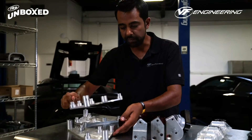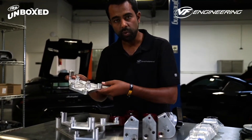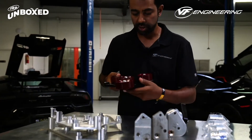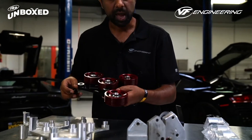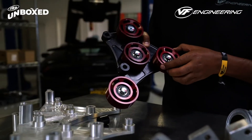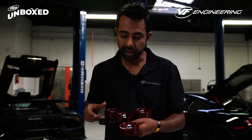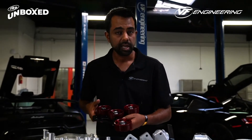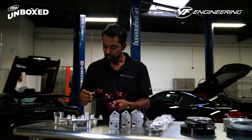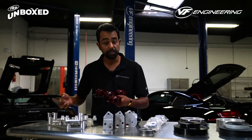We created a very rough, crude idler bracket prototype from a thin piece of plate and some spacers, then transposed those mounting points to a slightly larger version. That led to a pre-production piece which was thicker with pockets and webs to lighten and strengthen it. And then you'll see the actual finished manufactured version, coated in type 3 anodizing with aluminium pulleys. The actual bores are machined to four decimal places of accuracy so we can press fit the bearings — high-speed bearings designed to tolerate up to 19,000 RPM. Another feature is the boss which allows removal and insertion of a belt for belt replacement with minimal mechanical work.